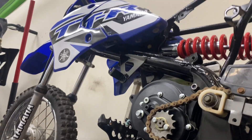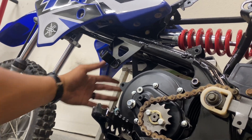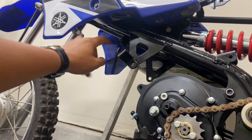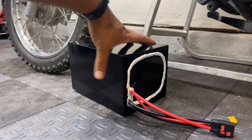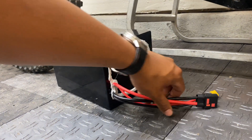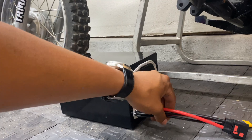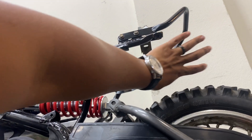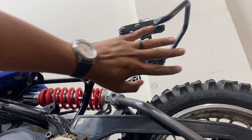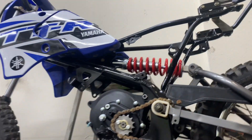As far as mounting the battery, I'm planning on building an aluminum tray that'll just bolt onto the frame, though I might have to cut off a few tabs to get the battery to tuck as close to the frame as possible. I'm going to rotate it so the cables are facing back rather than sideways, to reduce the chances of them getting caught on a branch on a trail. It also makes it easier to run the cables toward the back of the bike since I'm likely going to have the controller mounted somewhere in that general area, though it is very tight so I've got to figure out where I can make space.